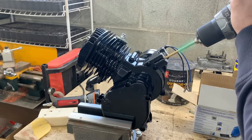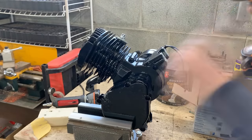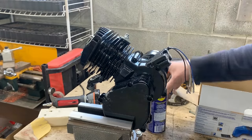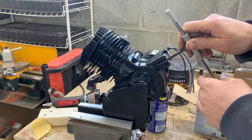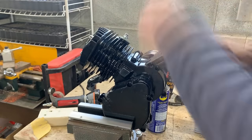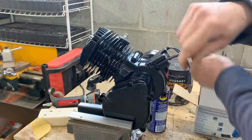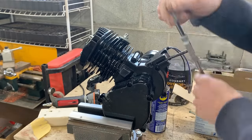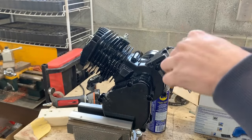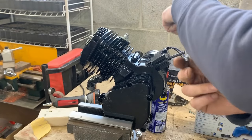Am I square here? We went into this bolt. That's fine. Okay, so now that it started, we're gonna start turning back. For every half a turn, we're gonna have to turn back and cut the shaving, otherwise we might make damaged threads.